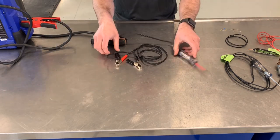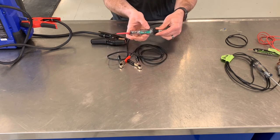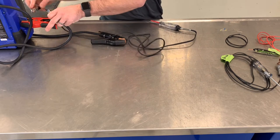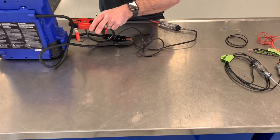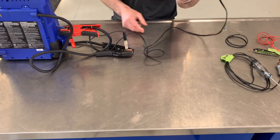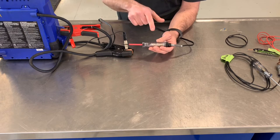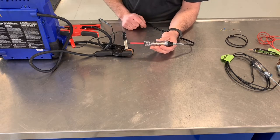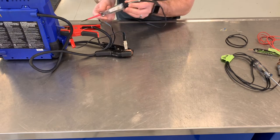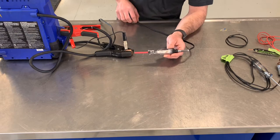The alternative could be something like this, which is often referred to as a logic probe — this one says 'automotive logic probe' on it. They come with two leads: one is meant for power and one for ground. I'll connect those to my jump pack. My logic probe has got two LEDs in it, so I've got both polarities established. Because of how LEDs function — only one way — I can go to ground and get a green light, or go to power and get a red light. This is the type of test light that we are going to build.